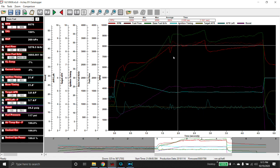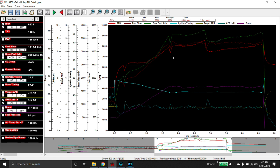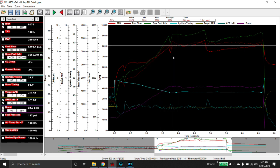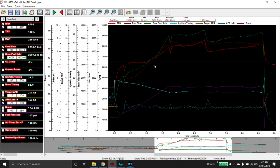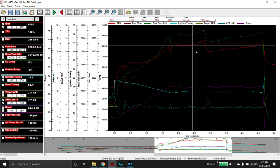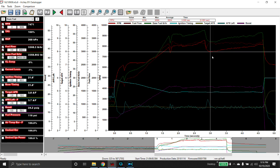The main problem here — and it's as dumb as it sounds — is that the car owner, driver, and crew (he's all in one) just didn't realize he was supposed to gap the plugs. These plugs are floating around 28 thousandths. If we were on smart coils I think we would have seen a lot more of this, but it's got an MSD Pro 600 so it still lit it off for the most part. The plug gap was just too wide. I commend the car owner — he covered everything else and just missed one of the basics. It didn't hurt anything; when he pulled the plug out it looked brand new. I asked what the gap was and he said, 'What do you mean? I put them in out of the box.' That's when we figured it out.